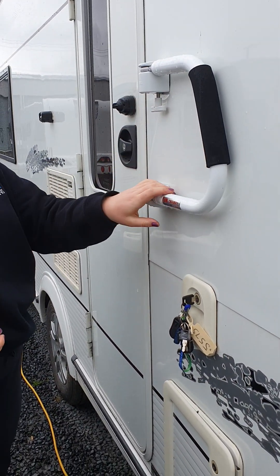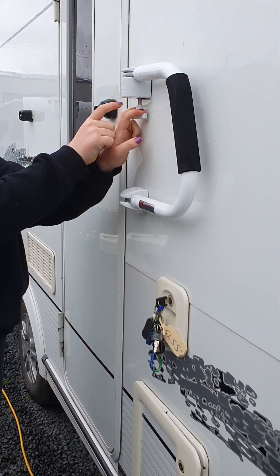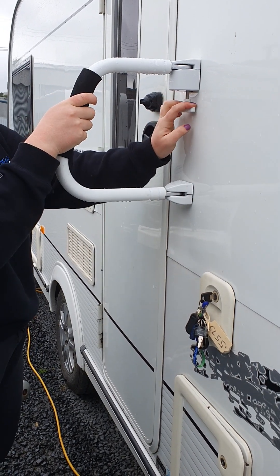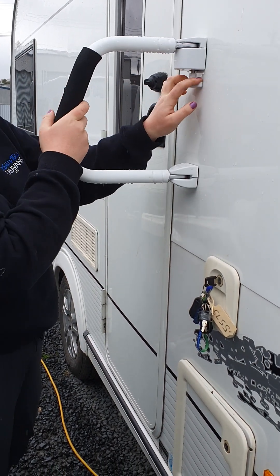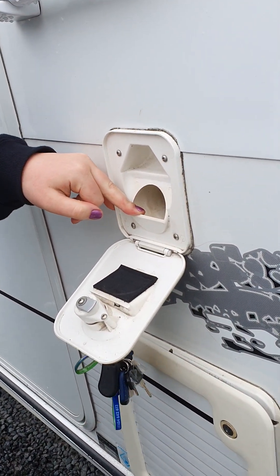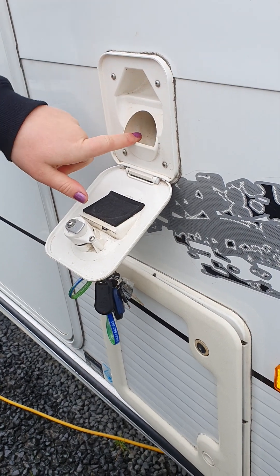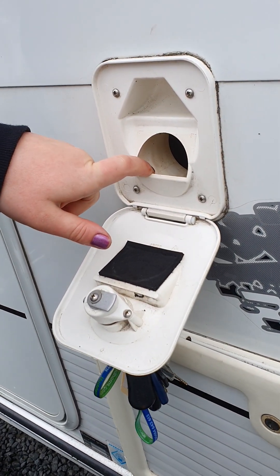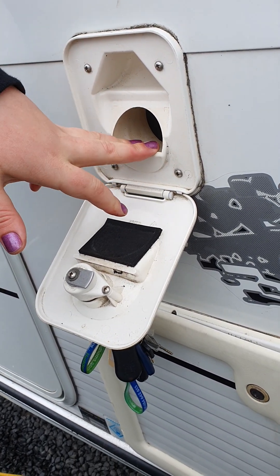Up on the other end of your van is your security handle. Pull this down, make sure it's unlocked at the side, pull this lever down and spin it around — you can lock it in that position to use it to get into the van, or lock it the other way for extra security on your door. Underneath that is the fresh water filler for your toilet. Depending on the model they generally take 8 to 10 litres — just fill it up with fresh water until you get some sitting in this trough. There is a pink toilet chemical that can go in with this fresh water to help with smell and to lubricate the seals inside your pump.